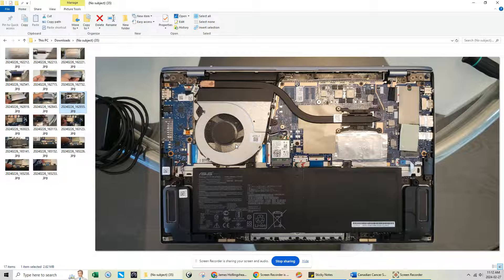The CPU fan is very simple. You don't actually have to remove the Wi-Fi card cable - a lot of people run into problems when they remove those two caps, so avoid that at all costs if you don't need to. Just tape it down while you're working on the CPU fan. The power cable for the fan - just use your fingernail and pop it upwards and it'll pop out easily. There are only three screws holding the CPU fan: top left, top right, and bottom right. Once you remove those, the CPU fan will pop up.